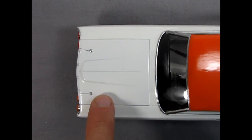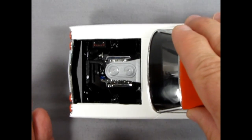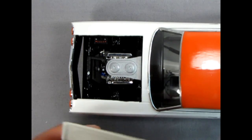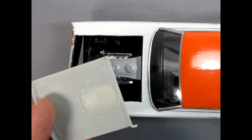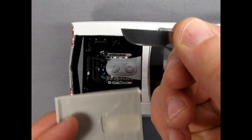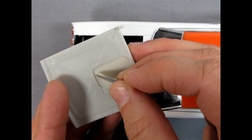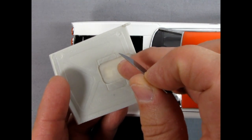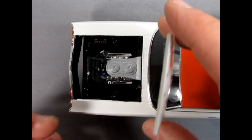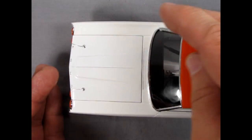Finally, after all that work, I have a nice fitting hood here, and you can see it is flat into all the corners and edges. And in order to do that, I did two things. So first off, I painted those air cleaners like I showed before and just kept opening the hood and painting them, then closed the hood and found out where it was leaving paint. Then I took this knife blade, you can see it's that curved one, and I just scraped in where that air cleaner was hitting and made a perfect concave circle right there. You can actually see it where my finger is. And I kept doing that technique, paint a little bit, close and test and all that. And now I've got it where it fits nice and flat.